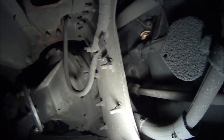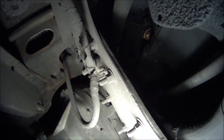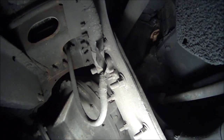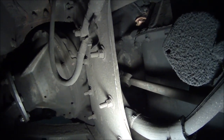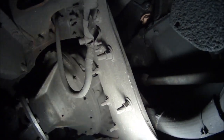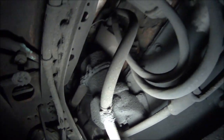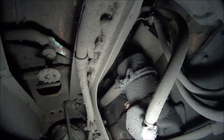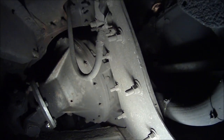You can see I keep a little rag — a little piece of paper towel right there. I had a leak earlier around the starter, tightened that up and made the leak go away. That piece of paper towel was there to see if it was leaking; if it was, it would be filled up. It's been there a couple of years. That stuff stays on there for an amazingly long period of time. You can see the bolts — I've snugged those up and it's dry around that pan.